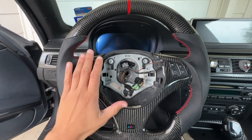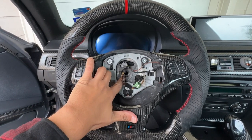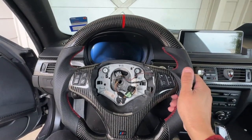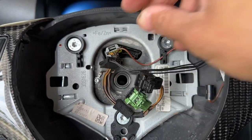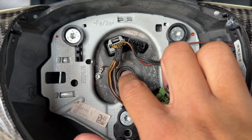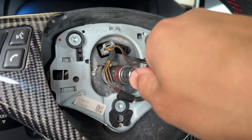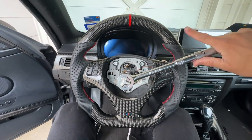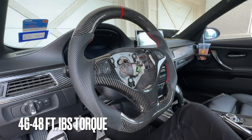The new wheel just slides over like this — you'll have to feel around for the sweet spot. There is a directional strip inside that's going to align the wheel. Push it into place; the center screw point is aligned and the wires are aligned. Go ahead and clip those into place — bam, just like that. Now put in the 16 millimeter bolt. Always hand-thread first, then use your knees to secure the wheel and torque it on extremely tight.